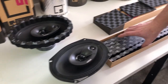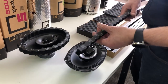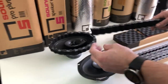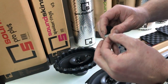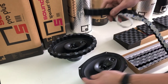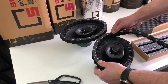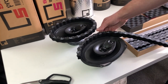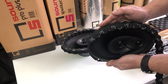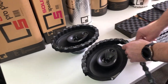The reason we give you six foam strips at this length is so you can do any size speaker — you're not restricted to 6-inch or specific speaker sizes. This one kit covers all speaker sizes. It has 3M double-sided tape on the back, so it's really high quality. You just peel that tape off and lay it around the edge of your speaker, then cut it with scissors to the size you need — very simple and easy. When sealed inside your door, it reaches out, couples, and stops the sound wave from going into the door cavity.